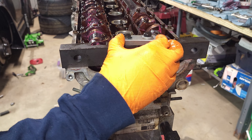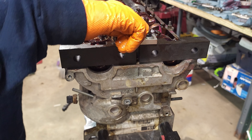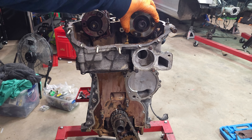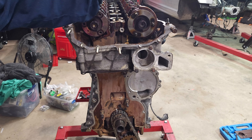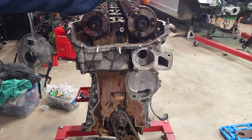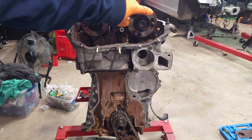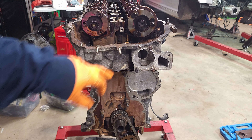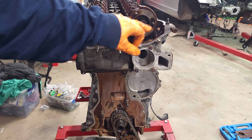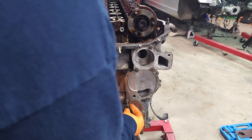I need to use the 24-millimeter wrench to turn the cam so that these sit exactly flush with the head. That one's in a good spot, and this one needs to go this way. This should be able to move freely to lock the two together. I decided to put this one on off camera — I was just looking up torque specs. It's got this moon-shaped face to the right, and it had an impression of the part behind it for this other shim. I had to look at old pictures of when I took it apart to get it back on there.